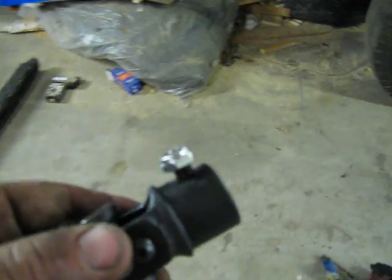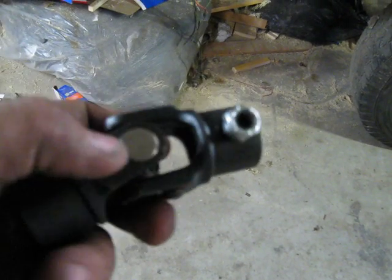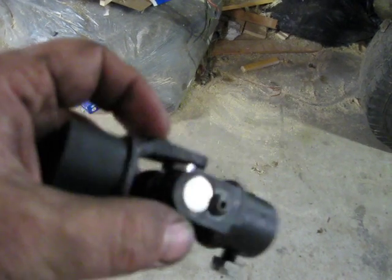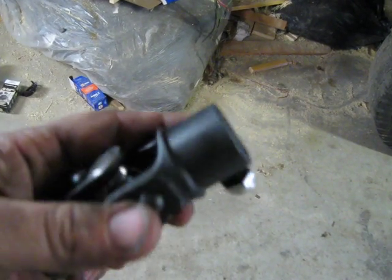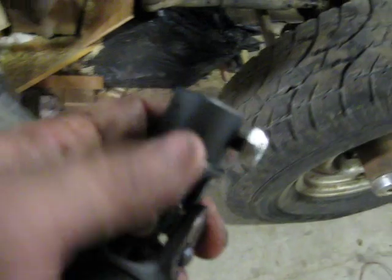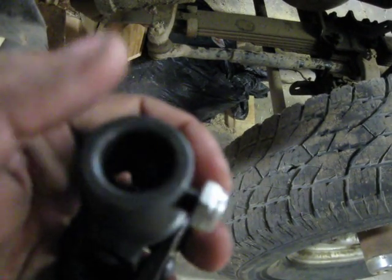Well, here we are another weekend. Got my parts in to fix this Dodge steering. It's a three-quarter inch smooth with a three-quarter inch 36-spline blind. I don't know how far up they go with that 36-spline blind, but I know the '92s and '93s are that way.